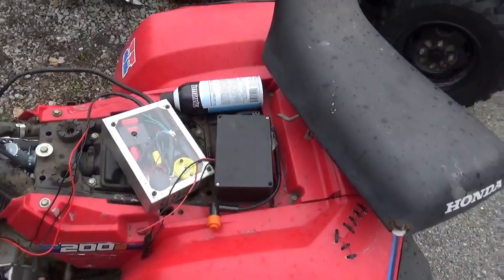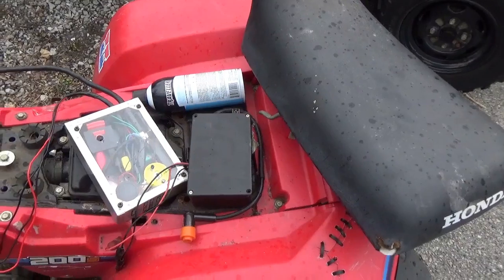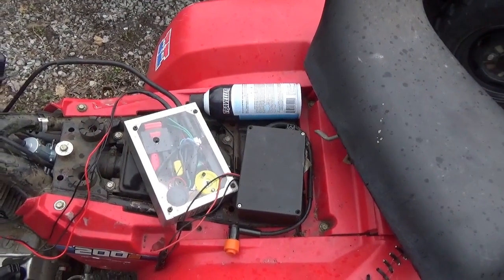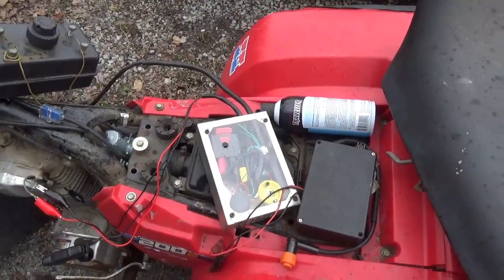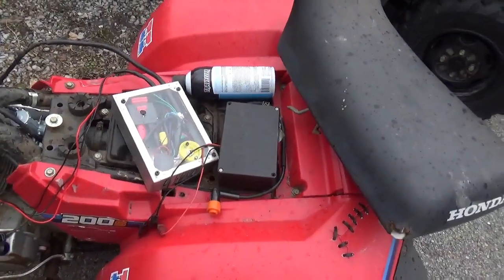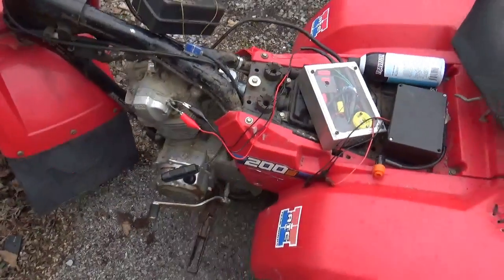I did put the switch on there — you can see the switch light up — but you can't be sure of how many volts is there. I built a second generation unit with longer leads. The CDI box I put into it was known as a 4-pin 12-volt CDI, which is more for the made-in-China 125cc units — much happier spark. The longer leads made life easier. Unfortunately, that was lost with my toolbox, which prompted me to make this third generation box.